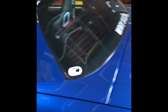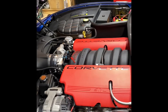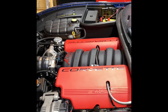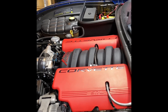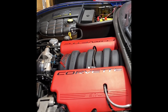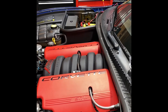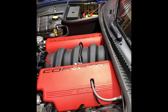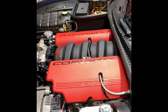This car had a lot of check boxes already checked off. It had the LS6 in there with a FAST intake — 90 millimeter, one of the first FAST intakes. It had a cam in there, a Comp Cam custom grind, long tube headers, AFR heads, LS7 clutch, and an aftermarket aluminum oil pan. The rear end has 390 Motive gears in it. The heads-up display had been redone. There was a lot of stuff already done to this car prior to me getting it.